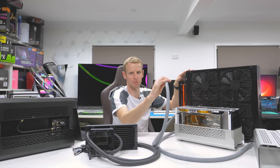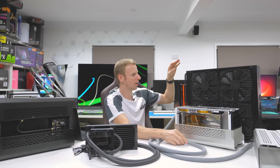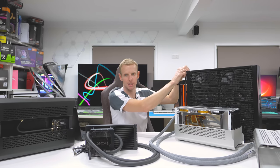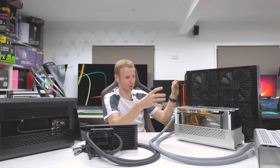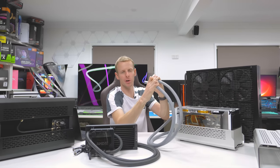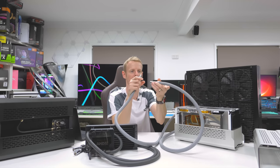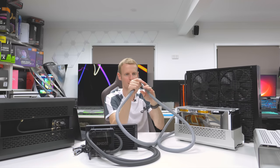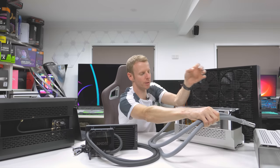You have to be careful not to accidentally power this unit on when it's disconnected from the system — if you don't have a complete loop, something will pop off. It probably won't blow the compression fittings, but it could shoot off a hard tube connector. That's actually why I installed a hard tube line there — so if it's accidentally powered, coolant just flows out there rather than elsewhere. To store safely, you could make the quick disconnects reversible — male to female on each side — so when stored, you connect the two ends together, creating a full loop even without the PC attached.